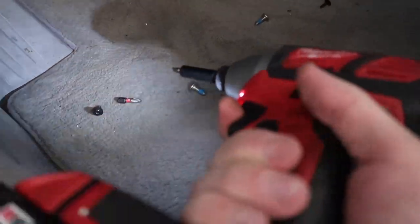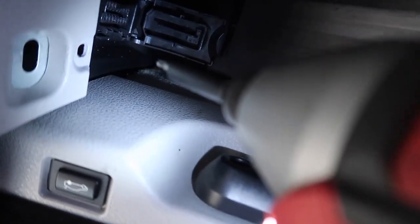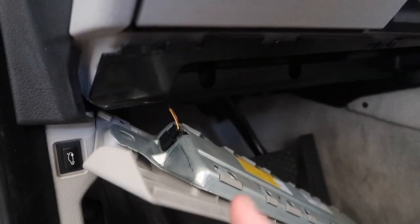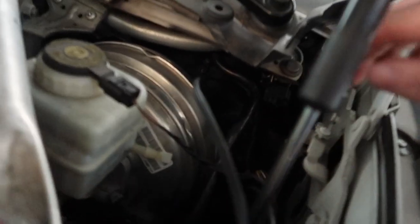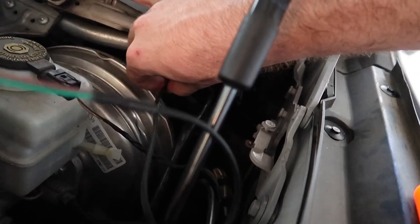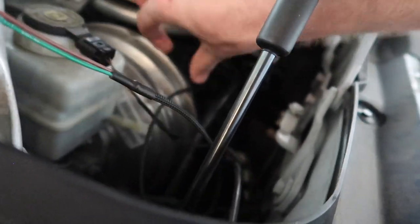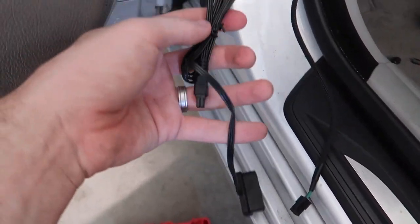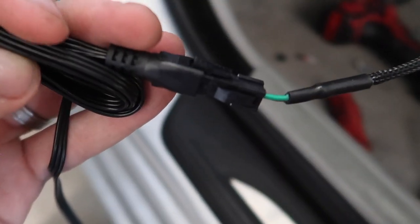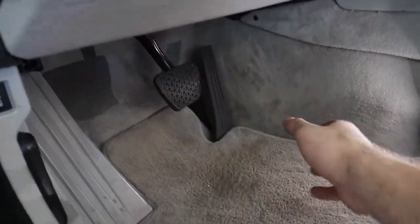To go through the firewall, remove this bottom trim — four screws total, one here, one there, same on the other side. Once it comes apart you can remove this piece, which actually has the airbag in it — that's why we disconnected the battery. Use a pry tool to pop it out; once you pull out the airbag cover it's just tabs. Then route the cable straight into the cabin through there, go inside and pull the wire down, connect it to the OBD, push everything back in, plug into the OBD, and it's all back together.